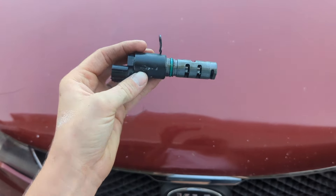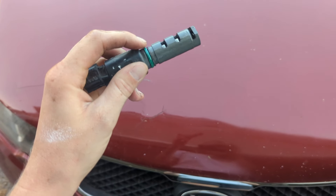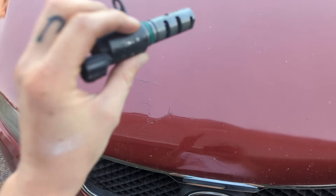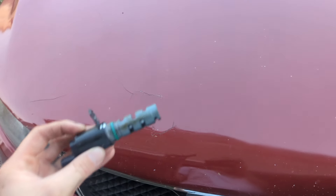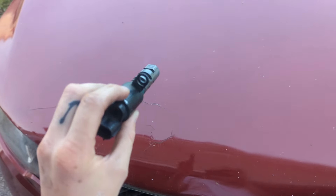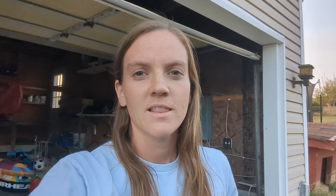One other quick tip: when you're putting this back in, it's a good idea to put a little oil on it and a little oil on your o-ring, just to help you slide it in. It is kind of a tight fit but it does go in, and the oil will help it slide in and not roll up your o-ring. Thanks for watching, I hope you found it helpful, and as always, stay independent out there.